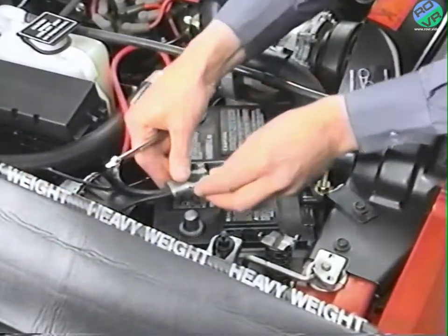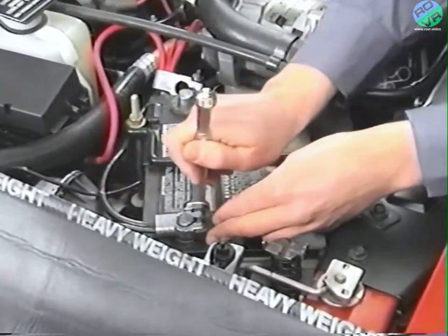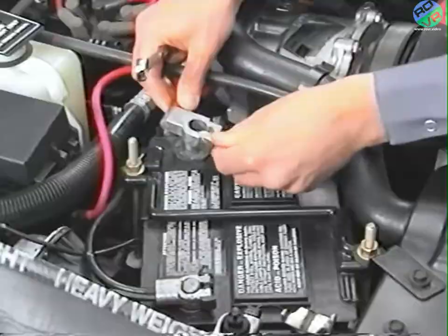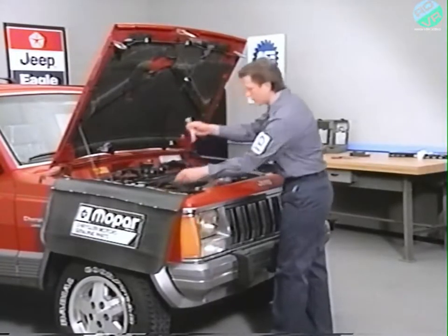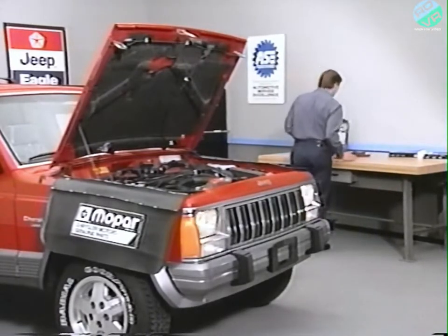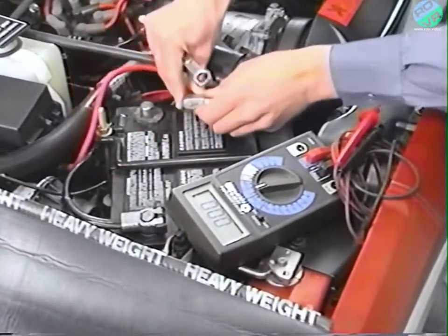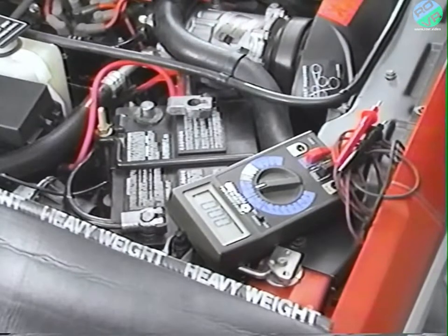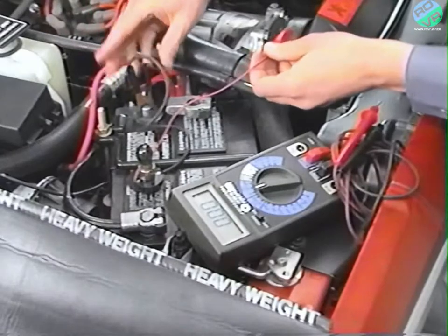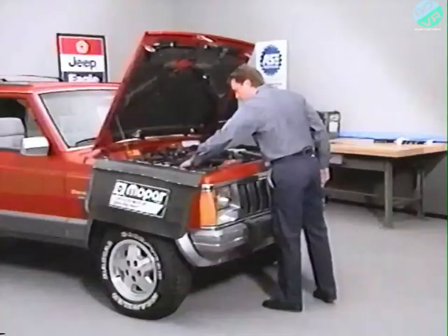One method of activation that you are sure to encounter occurs when the vehicle's power supply is interrupted. This can happen when the battery or SAM is disconnected. Upon the restoration of power to the vehicle's electrical system, the vehicle lights will flash and the fuel injection system will be disabled. The horn will not sound in these instances. When performing electrical service on a vehicle with this security alarm system, anticipate the additional power draw caused by the headlight activation when reconnecting the battery. Take the necessary precautions to protect your sensitive test equipment from possible damage.